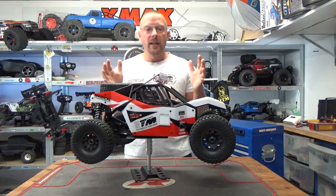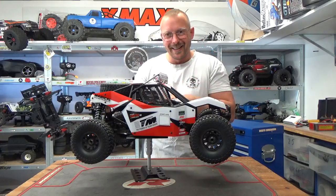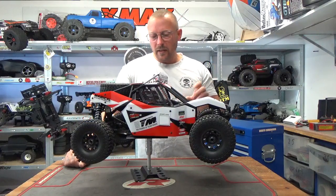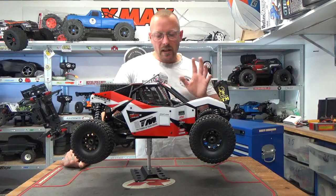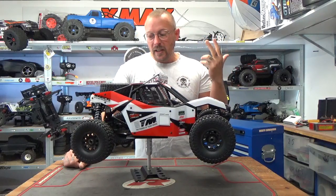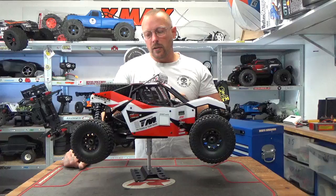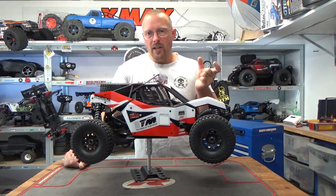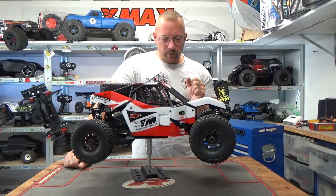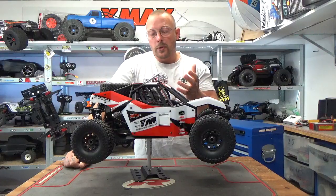And in the beginning I also thought that the 4S was based on the B8ER, sorry. And that's not the fact. It's really the same size as the 6S. Main difference between the two is body, electronics. And in the beginning, normally you should have plastic shocks on the 4S, and that's also the difference in the price. You get about 100 to 120 euro difference between the 4S and the 6S. But now, many of us who get the 4S get it also with the alloy shocks, so the only difference is the motor and the ESC.